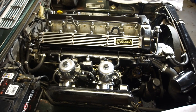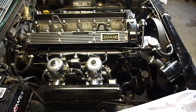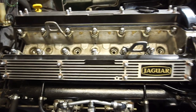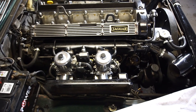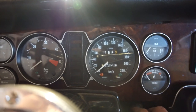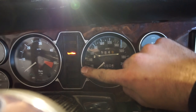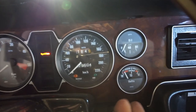Almost everything is ready for the first start. All the coolant hoses are new, all the fuel hoses are new, there's coolant in there, and I've changed the oil. Before I turn it over, I want to make sure we have oil pressure. I've removed the spark plugs and put a little bit of oil down in each cylinder. I'm going to crank it over on the starter for a while just to confirm oil pressure shows on the gauge. I've disconnected the fuel pump and ignition so it should just crank over. The oil pressure warning light doesn't seem to work — I think the switch is bad so I've ordered a new one — but the gauge worked before, so let's check that.